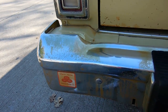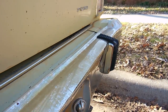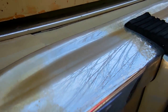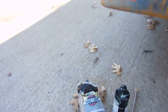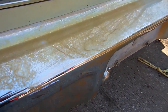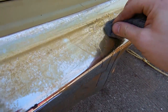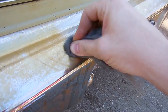I know you guys want to see better work on this car, but I want to show you guys this back bumper. That's how we bought it — basically just rust and oxidation from the car sitting. This spot right here is what I have already cleaned. Here's a trick: I did not use that polish. I use something way cheaper — fine steel wool and WD-40. I'm gonna try to do this with one hand. I didn't bring my tripod, sadly. Let's do this part right here — it's really bad. Go ahead and spray it down and just take this piece of steel wool and scrub.